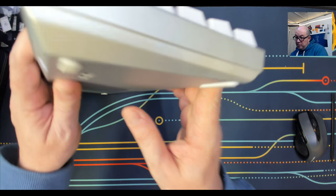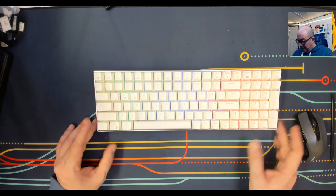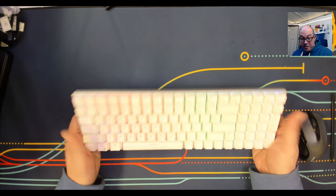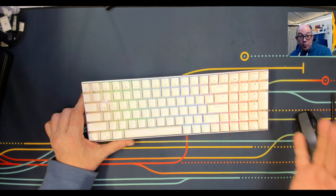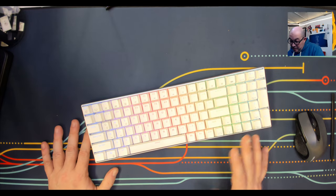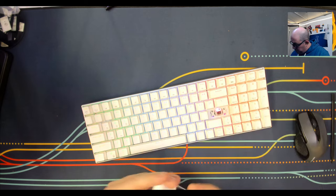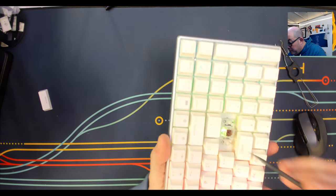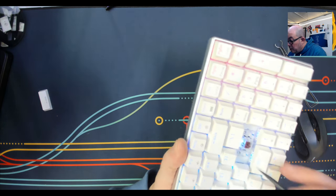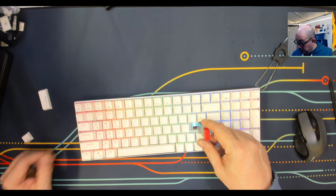This keyboard retails on sale right now for $69.99, and I've got to say there aren't many keyboards under a hundred dollars that you can get in aluminum, let alone this chunky of aluminum. We've got all the rest of the RK100 features except for the USB port. Looking at the stabilizers, unfortunately we have the milky color stabilizers, which are not my favorite, but they seem to be slightly lubricated — not too much, not too little. They are loose on the plate, and it does look like we're dealing with a steel plate as it is magnetic.